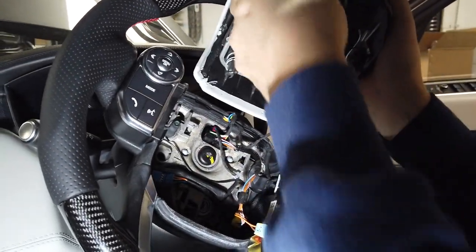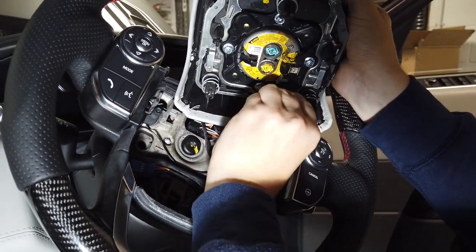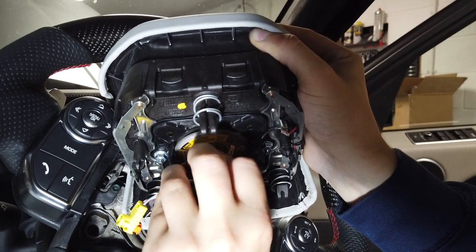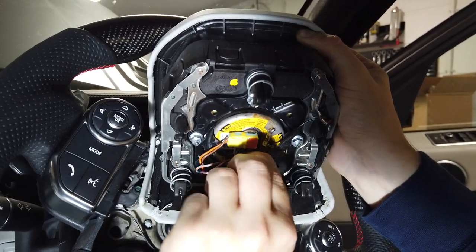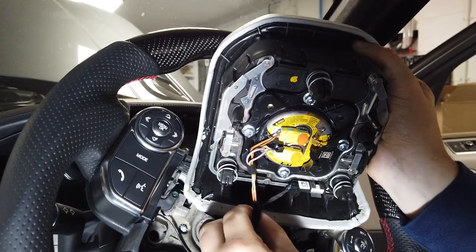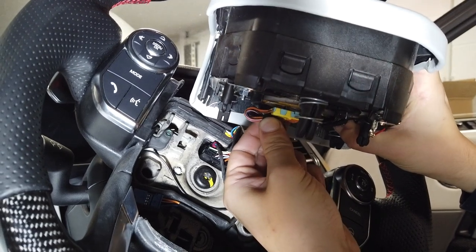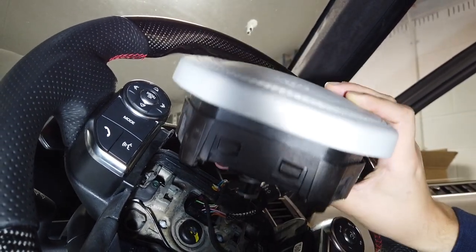That one's going on. There's the metal clip — do that. Have a go at the airbag connectors — push on the body, not on that middle connector, get the body and then push the orange connector home. They're color-coded so you can't get them wrong. Route that cable into that little hook. The tape there should stop it getting in the way as you put it all back together.